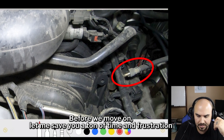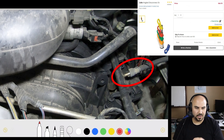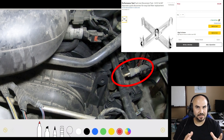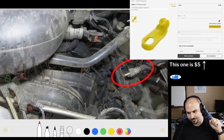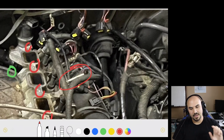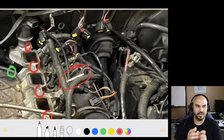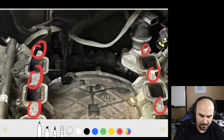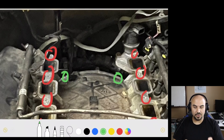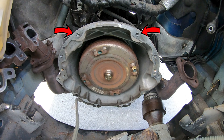This part right here is the fuel line attachment. There is a fuel line disconnect tool available at Harbor Freight, Advanced Auto Parts, or AutoZone — about $10 to $15 depending on the pack. It literally takes four seconds: the tool goes around the shaft of the pipe, you slide it up, it disengages the lock, and you can pull the line right off. The reason for doing so is that there are two bolts accessible from here — these are 15mm — at the top of the transmission, and I'll show you those now.